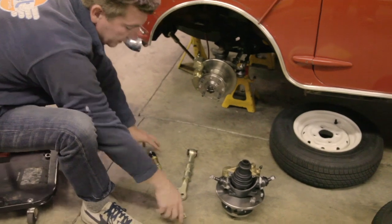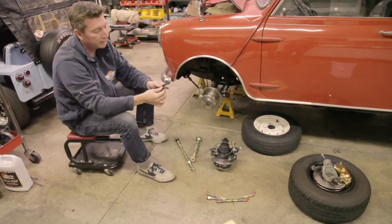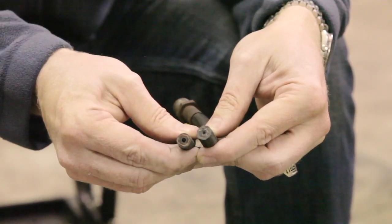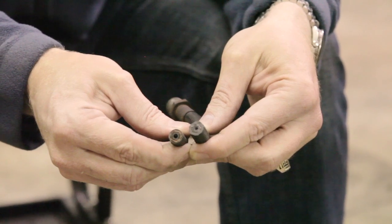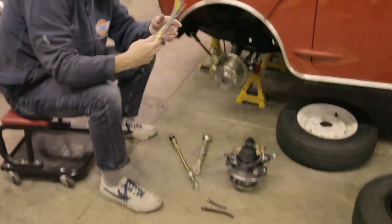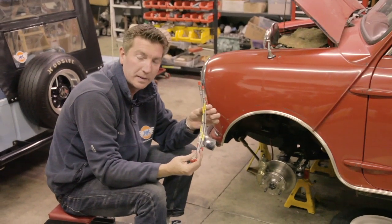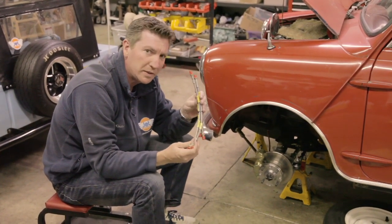While we do these, we always notice the rubber brake lines. Rubber brake lines might look okay on the outside, but what's really happening is the inside of the brake line has swollen up. Rubber doesn't like age or heat, so we replace all rubber lines with stainless steel braided brake lines. It makes all the difference in the world — gives you a good solid pedal feel, none of that spongy rubber.